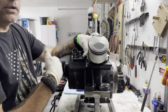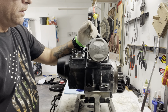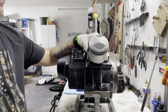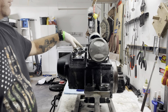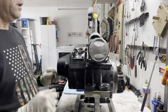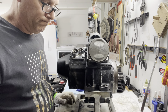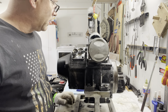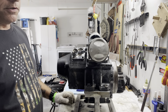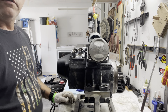Then release the compressor and take it off, and lower it down. I use Marvel Mystery Oil to coat the inside of the jugs — just for easier sliding. You should do that anyway — always coat the insides, especially after honing, otherwise you can get some pitting or light rust if it sits too long. And that's it.